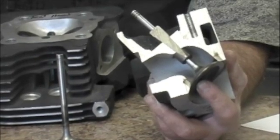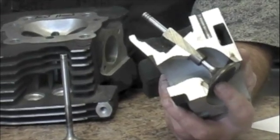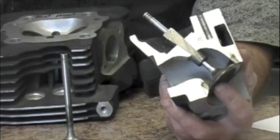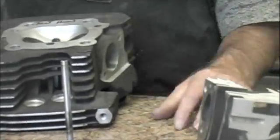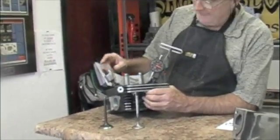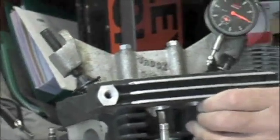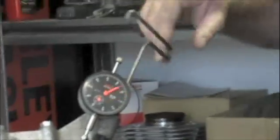I'm going to show you another way of looking at TDC lift here by opening the valves up to the specified height. I've got our truck valve lifting device on here. I've opened the intake valve to 209 thousandths and now I'm going to open the exhaust valve to 187 thousandths.